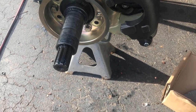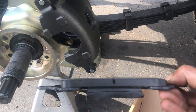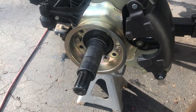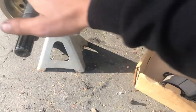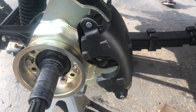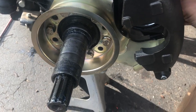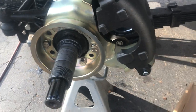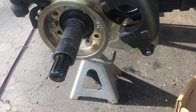But as your brakes wear down, obviously, when they get closer to your backing plate here, that caliper needs to slide to take up that extra slack. So that'll get closer, but it'll always stay faced front on the rotor. And your back piston here will make up for that extra clearance in your brake pressure. So it'll hold more fluid behind that piston, so it'll take up that clearance. And then once you press down on your brakes, you'll still get that same braking pressure.